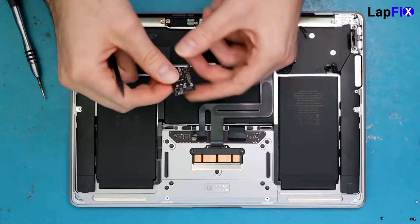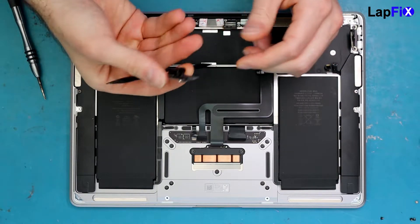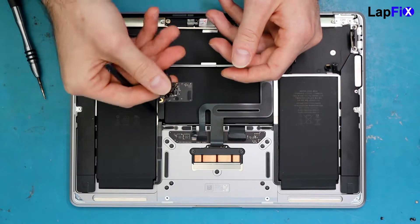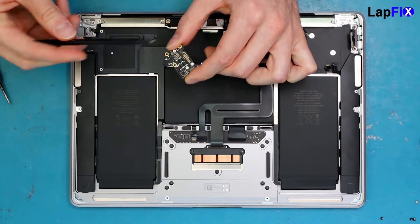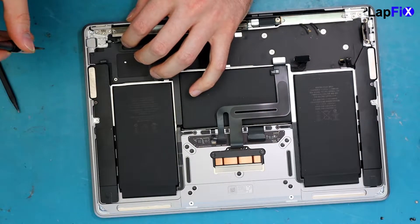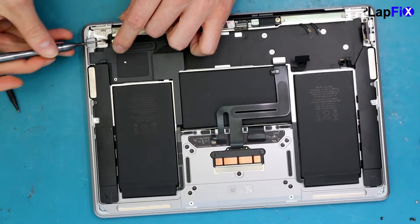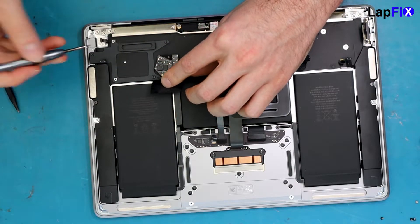This is almost a teardown video too. This one is good because it actually does have the power button here — sorry, I'm used to saying home button because it's Apple. You can see where the power button is. To remove it, there are six screws over here, and as you take it up there's this little flat tail cable — that's the power button cable.